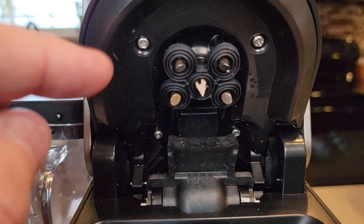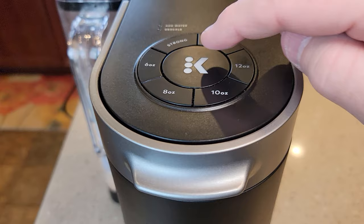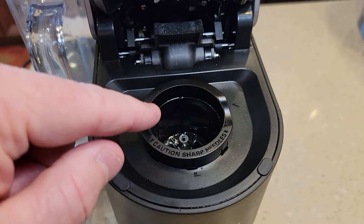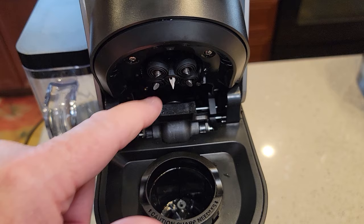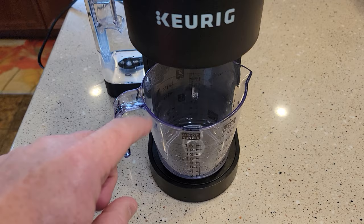Now you might get some crud out — you can rinse this off, but we're going to do a fresh water rinse with the Keurig. That'll force some through, and you may have to do this a couple of times. You may have to poke these holes and then close the lid. We're going to pick eight ounce, hit the K button, and just fresh water will rinse through. These things can get pretty dirty, especially this area — you can get a lot of coffee grounds in here. You definitely want to keep up on this. Keurig sells a rinse pod and those work really well too, but they don't necessarily get in there and clean the needles like you should. Close the lid, make sure there's no K-Cup, hit the eight ounce, and just run fresh water through. Be careful — those needles can be hot after a fresh water rinse, and that area can be kind of hot. You may see a bunch of gunk come out, but you should have a pretty nice stream.